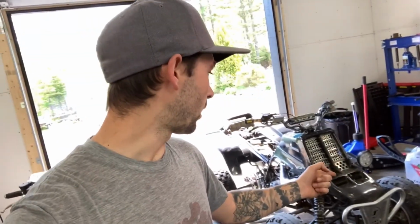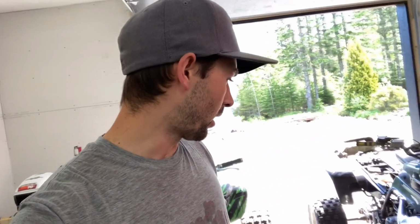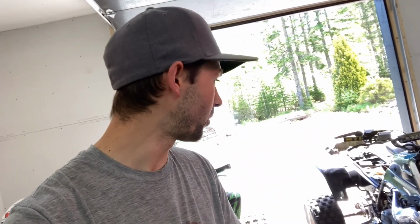Hey, what's up guys? So today I think I'm gonna be working on that Banshee. I was having some troubles there last week. It was starting to overheat and I took it out for one last ride and then it stalled out. So not really sure what's wrong with it. It's not burning up coolant, so I don't think that it's the head gasket. Could be, we'll see. I'm gonna try a few other things first.